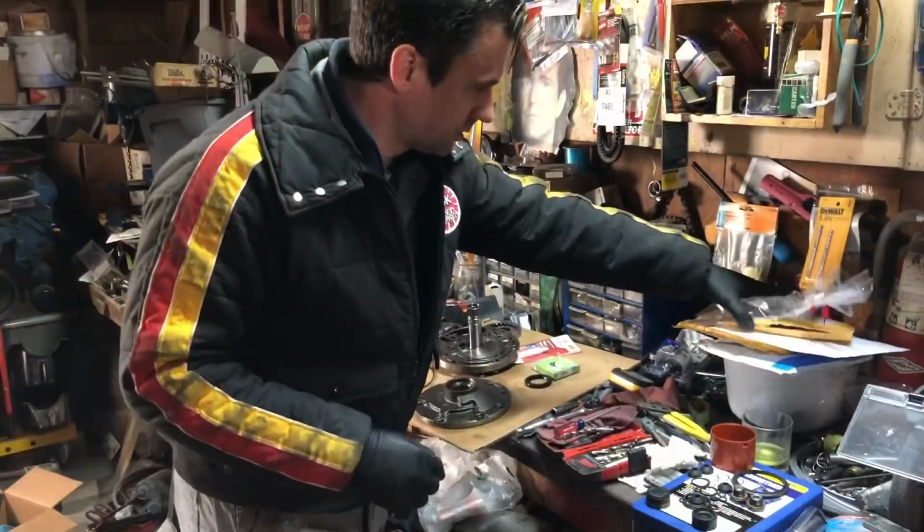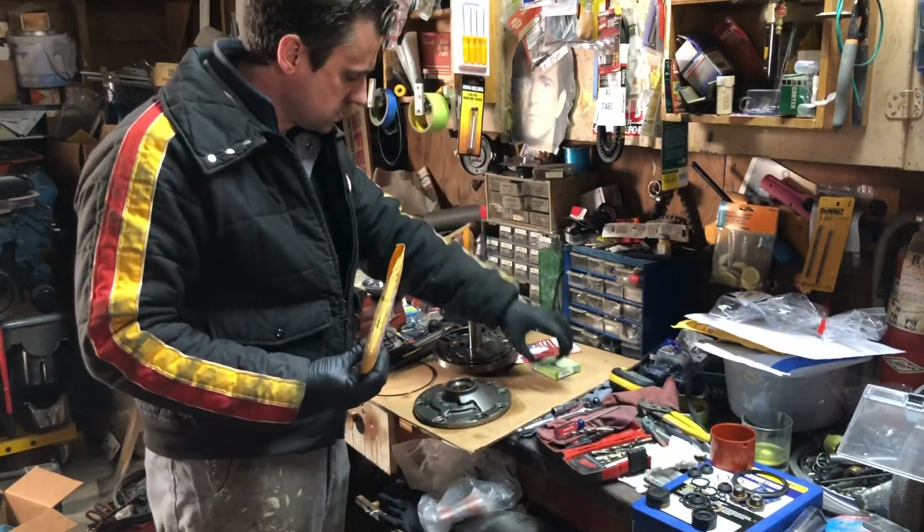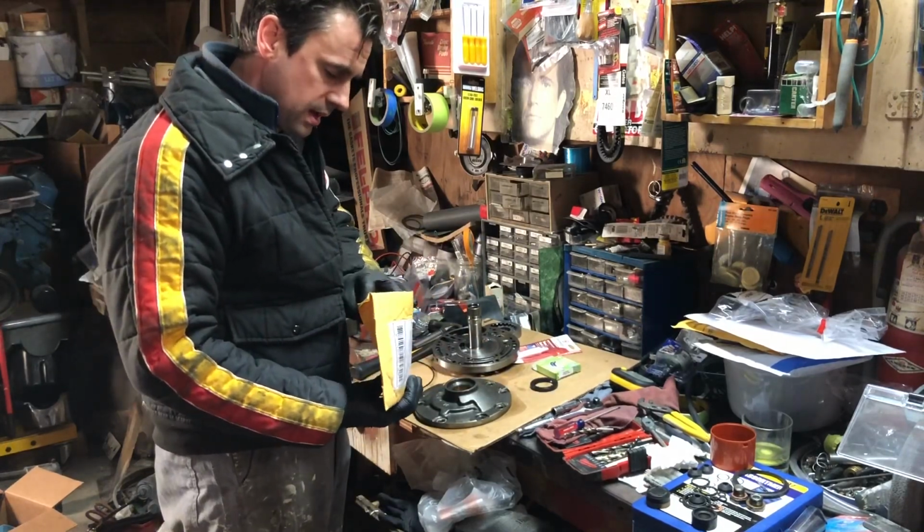So once I finished working on the air boxes this week, I switched back to the transmission pump. The bushing came in that I was waiting for, and that all went back together real smooth. Put the bushing in, put the torque converter seal back in the pump, and then it bolted right back on using some sealant. I'm going to replace the bushing, and I'm going to replace the front seal. We can put this back on the tranny next and have that out of our hair.